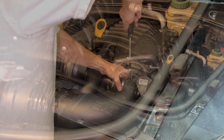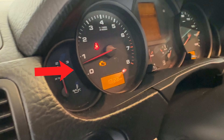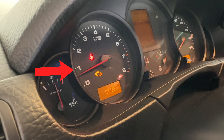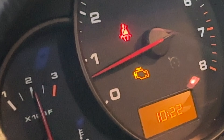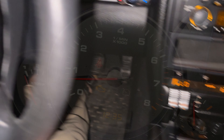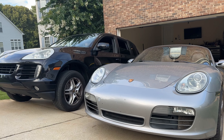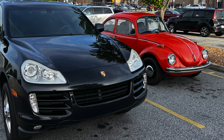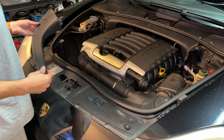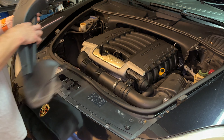Link in the description and on my channel. The issue: at a stop, the Cayenne would vibrate because the RPMs were too high, around 700, and it would try to correct by dropping the RPMs too low, almost stalling itself and shaking, then rinse and repeat. After the procedures in this video, even with AC at full blast, the idle remained a smooth 600 RPM. I had a substantial improvement in how my base model 2008 VR6 Cayenne runs. Note there are important differences between the VR6 and the V8 — this guide is specifically tailored for the VR6.